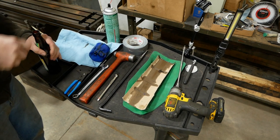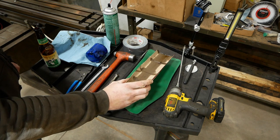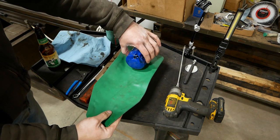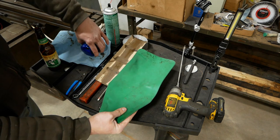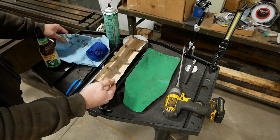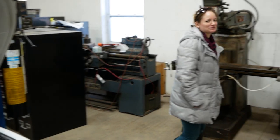Alright folks, that's the last job of the day. What do you guys think? The cardboard definitely works and the price is right, but it's not as convenient as the Forma funnel. I've tried in the past taking the Forma funnel and trying to shove it clear up underneath of the oil filter, and it just doesn't work. There's not enough of a lip there or whatever — it gets moved out of the way and you still end up spilling the oil everywhere, so piercing the filter is definitely the way to go. But you guys tell me what you think. If there's a better way or something I haven't thought of, type it out in the comment box — I'm all ears. Because there's tons of these 3600 V6s around and this job's a pain in the butt. So that's it. Thanks for watching. I'll see you next time.